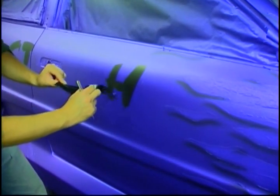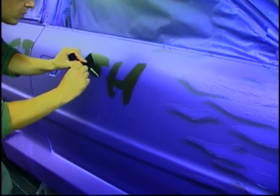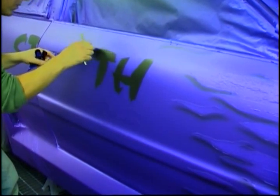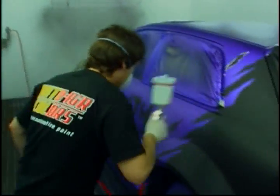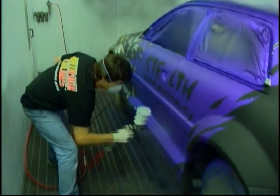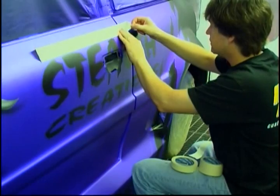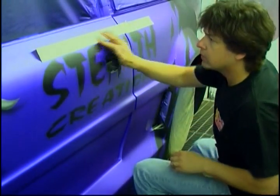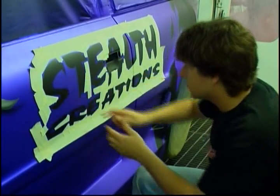About 12 or 13mm, or half an inch, which will remain black. I'm just exposing the inner parts of the letters at this stage. I've removed all the masking and I'm sealing everything in with a transparent base. I always use the transparent base over the top of the hot rod sparkles or sparkle flake, because it seems to fill them in a lot better for me. It means it takes less clear to fill them in. It also has good UV inhibitors, and just one or two light coats will do. I'm now starting to mask up the design, just making sure I've got every area covered.